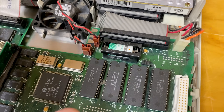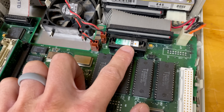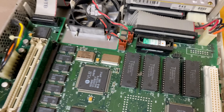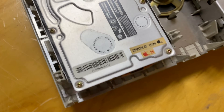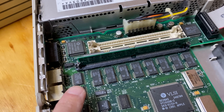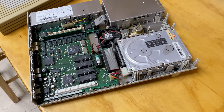The pressure builds up and then they burst. And when they do that, electrolyte will just corrode everything that it touches. So if you have an older machine, just take these batteries out — especially these little half double-A size batteries — pull them out. You don't need them for the computer to work. The clock won't be accurate, but who cares? It looks like it's got the original hard drive in here — 80 megabytes, Quantum. These were SCSI hard drives. It also does not look like the machine has ever had its RAM upgraded, so it's got four megabytes of RAM soldered to the motherboard but the expansion slots are empty. So this thing basically is completely stock from when it was new, which is actually kind of neat in and of itself.